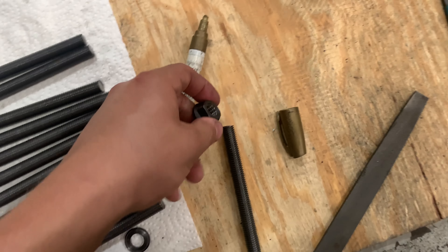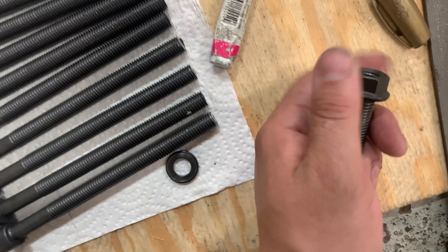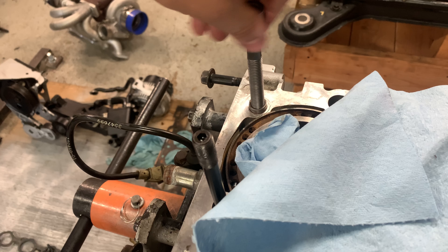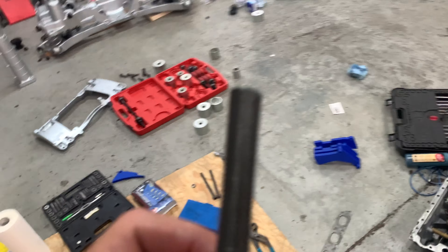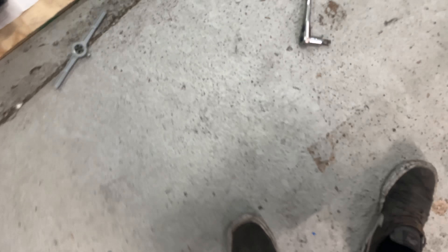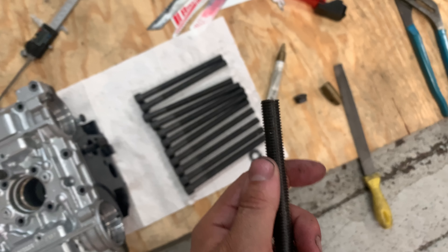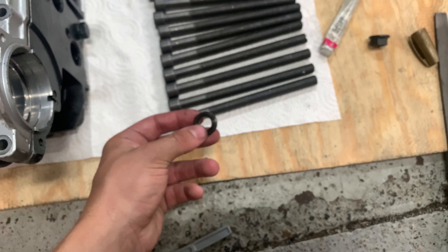All the bolts are cut down to 155 millimeters measured with the washer on. If you cut between threads three and four, it cuts a lot cleaner and you'll have an easier time cleaning it up. Most of them I didn't have to clean up too much — just chase it with a nut. You can see the nut goes on so easily. Test fit it in the block — it goes in by hand, no problem, doesn't bind up or get snagged. Just make sure to remove any sharp edges with a file or cut with a grinder using a cutoff wheel.